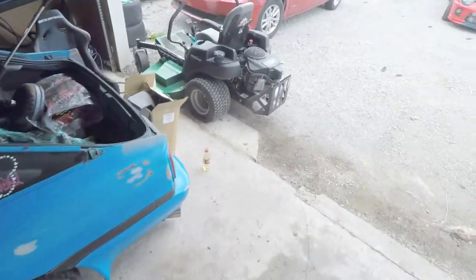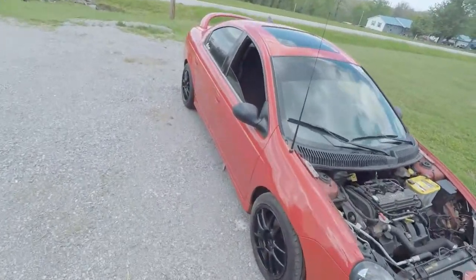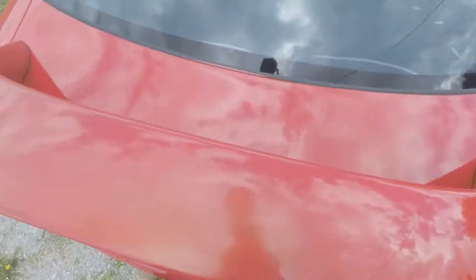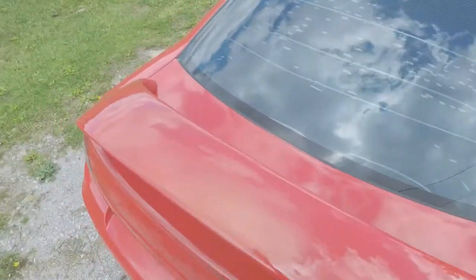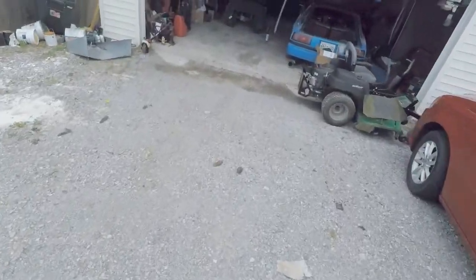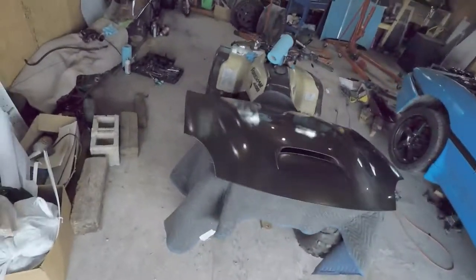It's not really turning out exactly like I wanted. I might have to do something different. Kind of wondering what it would look like on this red — let's try it somewhere just to see. It's a bit more gold than I thought. That actually might look pretty good on the red. Pearls are extremely hard to spray — everyone says it and they are 100% correct. Pearls are hard to spray. Out of this can makes it so much harder because it's not coming out in a nice wet coat like it should. When you do something small it probably comes out a lot better.